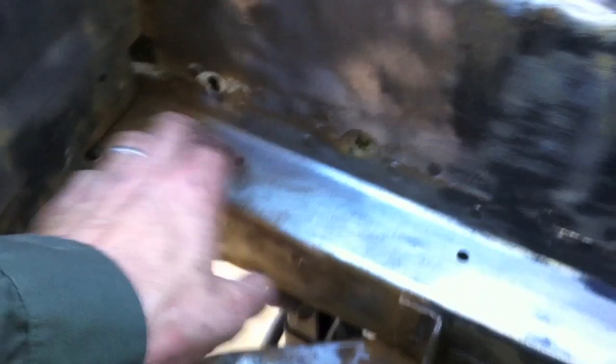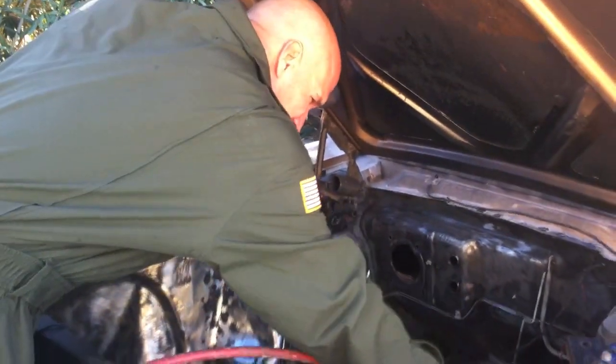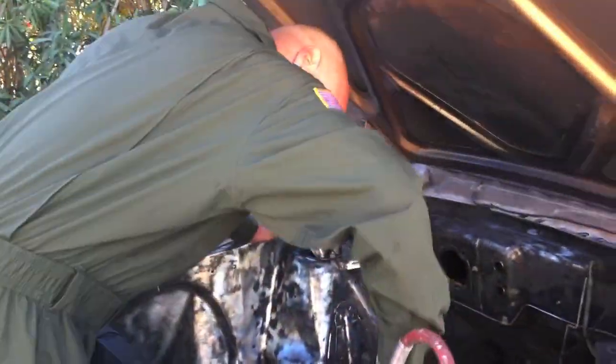She's ready to get some primer neutralized on her. Every little bit has been pretty much sanded and we're going to go through and neutralize. This is just dust — I'm going to blow her out with air and start to hit her with some quick primer spots just to seal her up tonight. We're going to be working on final paint tomorrow for the 64 and a half. Just blowing off the dust, getting ready for paint — exciting time.